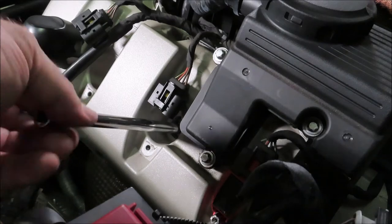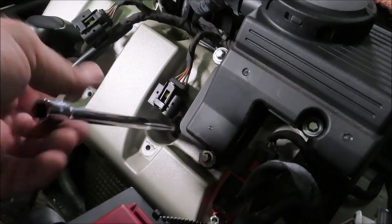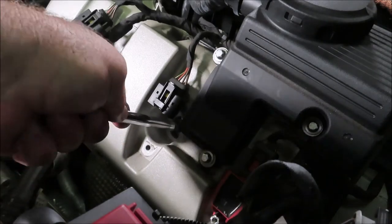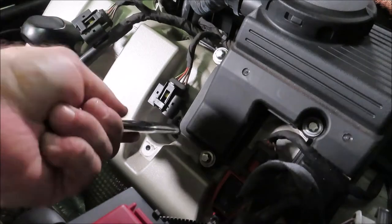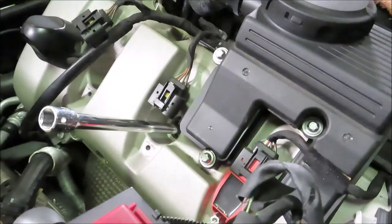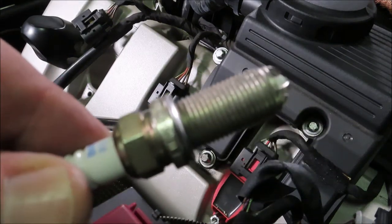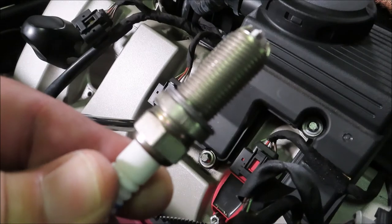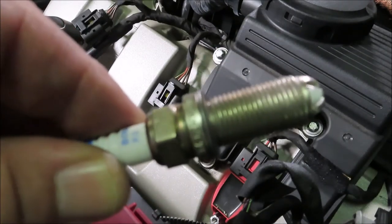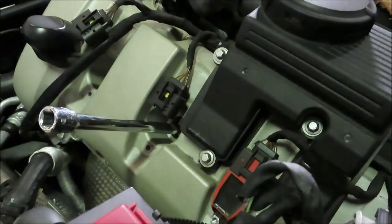You saw in there was that little washer, that crush washer. That's what we're doing right now. So right there, I'm at the washer. There, stopped. Let me show you what I'm talking about. This is that crush washer there. You can see it has, if the camera will focus on it, multiple layers to it. It's designed to compress down. You can see it there. There's like 2 kind of parts. So that's what I do by hand. I tighten it down to that.